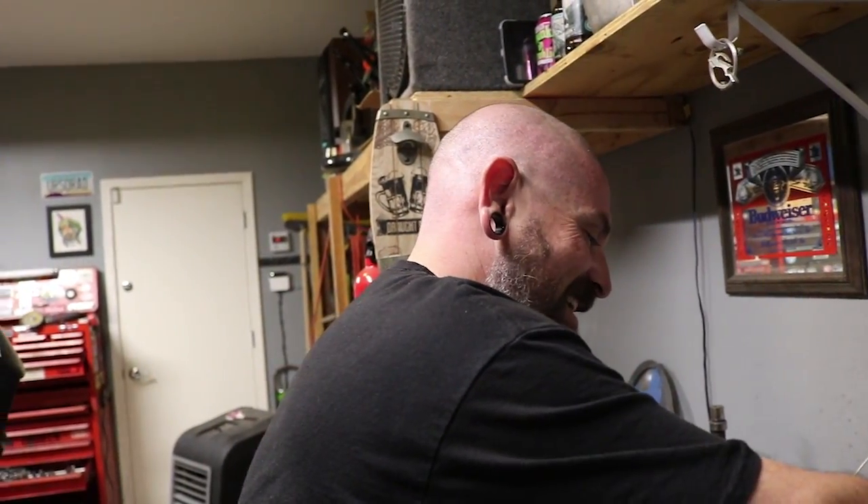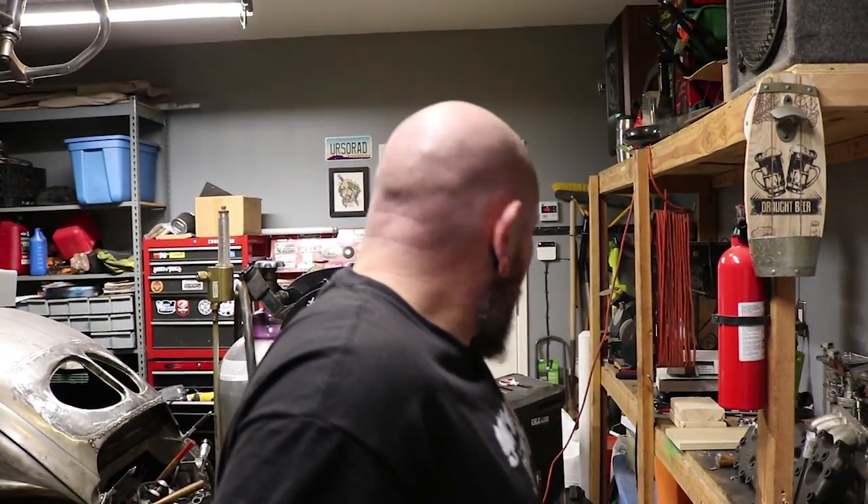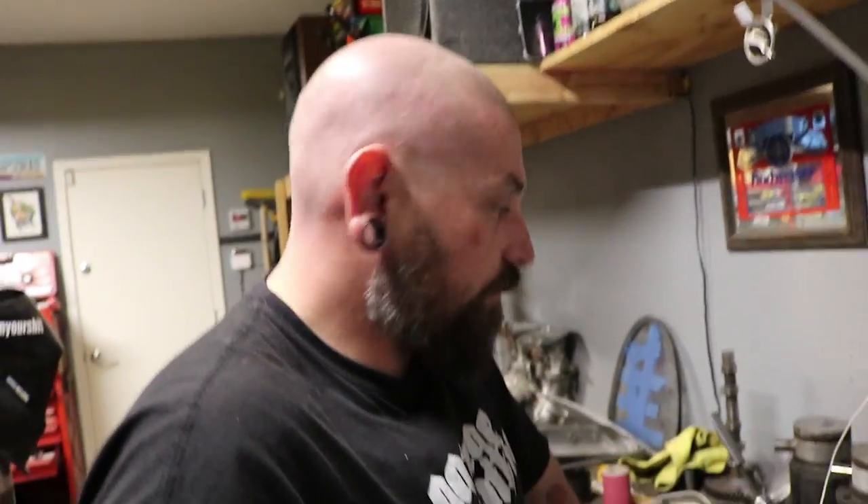The dumpster motor was built with pieces I just had laying around. I balanced the rotating mass like I just showed you, so the actual rotating mass was good — but the case was garbage because it was a garbage case to begin with. So we covered the internals: rods, pistons, balancing. Now working our way outward — after the jugs we have heads.